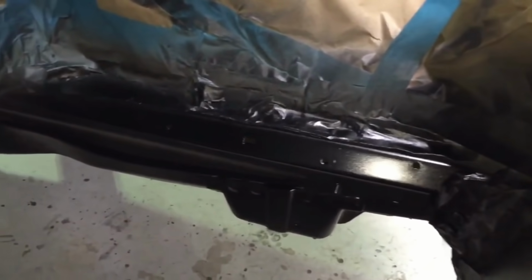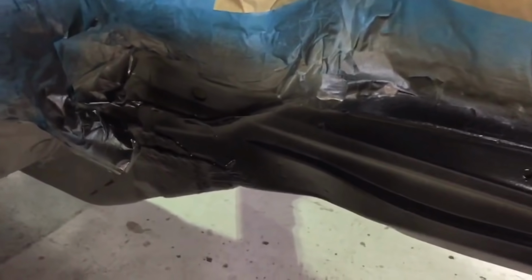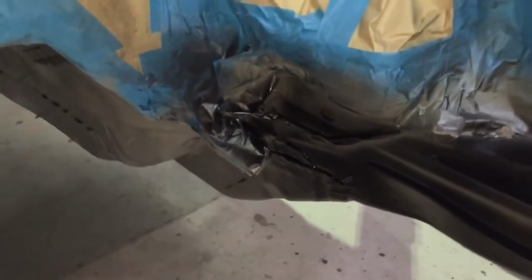The sapphire black base coat's applied to the engine bay now, so just as it would land, trying to replicate the factory finish where they don't get much on the underside sections because it's all sprayed from above by the robots, and then it's gently blended, and whatever is the high point picks it up. And the same with the left chassis leg, matte finish, no gloss on there, and blends off into the tunnel at the back of the chassis legs.